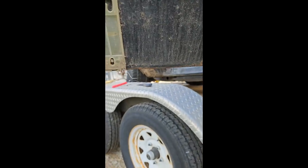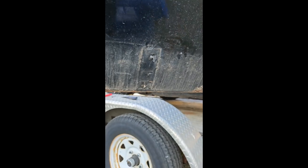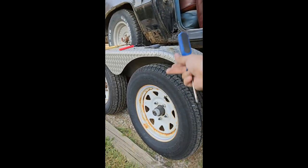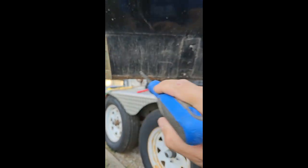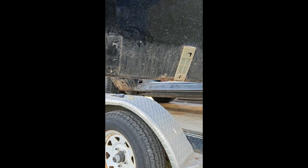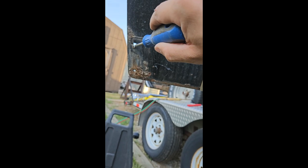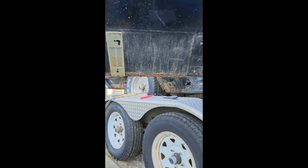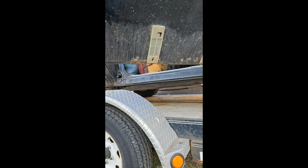Same thing with these — you can just take a little screwdriver, knock them off to the side, pull straight up, and they remove. I keep all that stuff off the cars. Then you've got studs — these studs are on the door. They do not come on a door skin. So if you get an NOS door skin from me, you're not going to have these studs. You will have the holes, which are alignment holes so you can put the door skin on, but you will not have the skin studs.